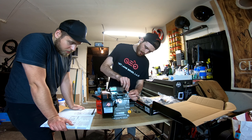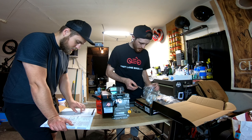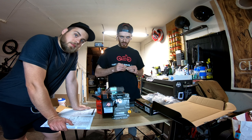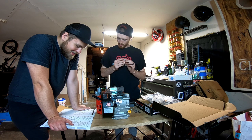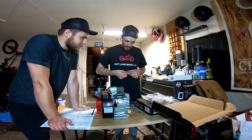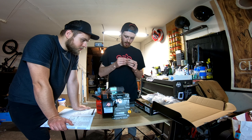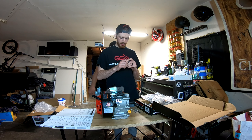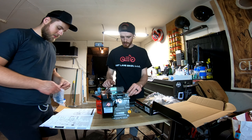You need the o-ring — do you need the o-ring? Yeah, grab it. This is for the big one or the little one? The little one, the one that fits over that. So there's this one and then there's this one. I think it's this little guy. So this top piece here — I just put this o-ring on it, yeah, go all the way to the top. This guy here is for the fuel pump — it provides pressure to the fuel pump. That little brillo pad in there is to stop oil blowback from getting into the fuel pump, essentially, because you're using pressure.